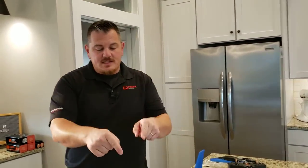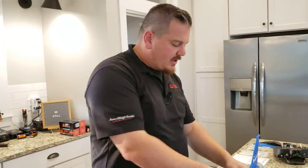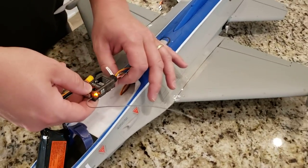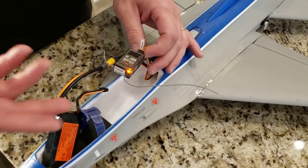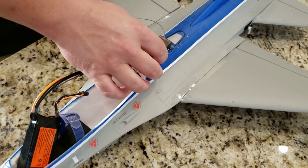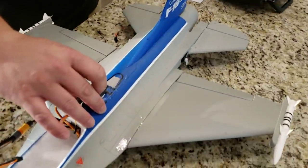But now what direction is the correction going to occur? Because if this is AS3X equipped and it's already programmed, oh, the third option, of course, is to reprogram the receiver so that you reposition everything, okay? But there is a trick, and the trick is very simple. This receiver is going to compromise SAFE, because SAFE won't know what position you're in. So we will unbind in SAFE and bind in AS3X only, because I don't care about SAFE. We might be able to get away with doing that. That should fix it.